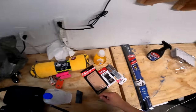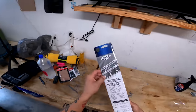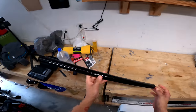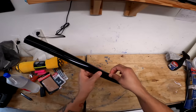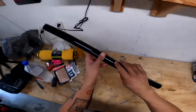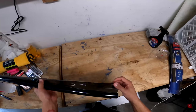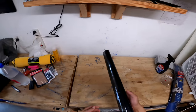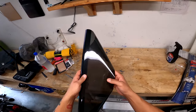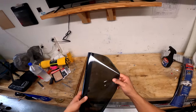The tint — just because we only have six feet to use — maybe I'll go ahead and pre-cut it now. Just be careful. This is how the tint is going to be: it's raw, not wrapped in anything. Go ahead and peel off this tab from the red tab, pulling this way. If there is a little bit of residue left on the tint, don't worry about it. If it's done correctly, this should be the liner side. For those of you that have never dealt with window tint, there is a liner on the adhesive side that you're going to have to remove before you do the installation.